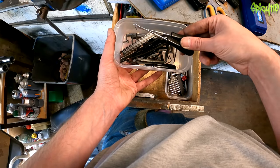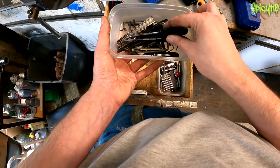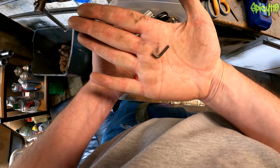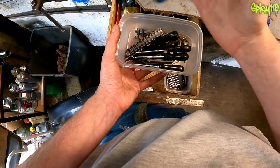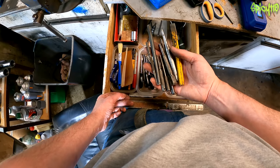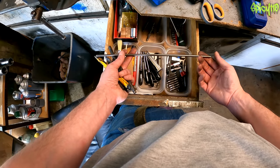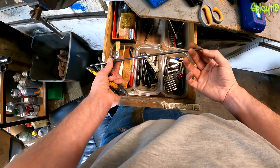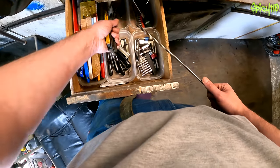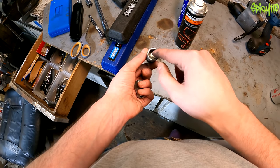If you're working on suspension or O-rings, a pick set can be very helpful for getting things out of tight spaces. I also have an assortment of punches and chisels — you don't want to be in a position where you're using a punch on things, but it happens. You can use a piece of mild steel as a makeshift punch, though be warned the end will round over time; proper hardened punches won't do that. Also, some bikes have front axles that require a special spindle tool to undo — these come in multi-size sets and aren't very expensive.